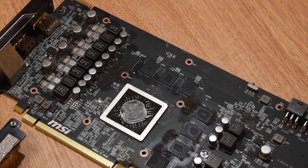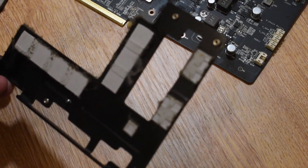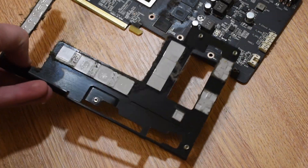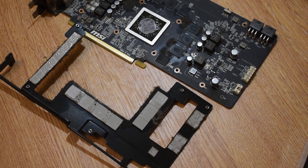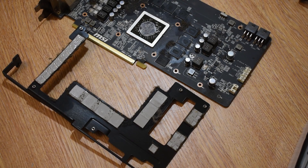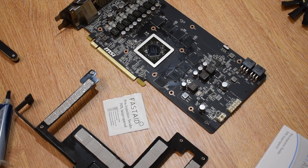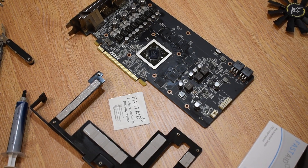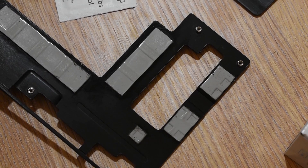What I'm going to be doing is using some PCB cleaner — or ECB cleaner, electric circuit board cleaner — dousing the PCB in that, and then going over it again with some isopropyl wipes. When it comes to the thermal pads, they're still in really good nick; there's nothing brittle here and other than a bit of surface dirt they look pretty good. We could reuse these pads simply by cleaning them up — cleaning the pads with a little isopropyl wipe actually brought them up nicely — but I happen to have a few extra thermal pads here so I'm going to replace them. At a push though, you could simply reuse the originals.